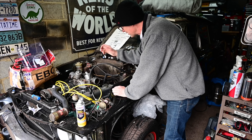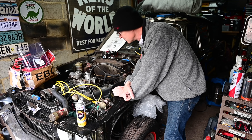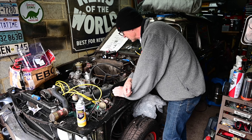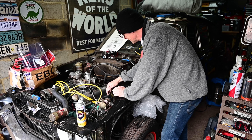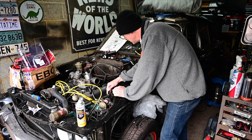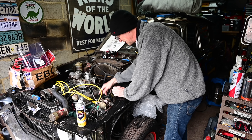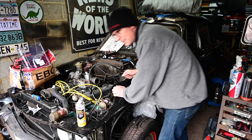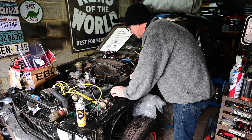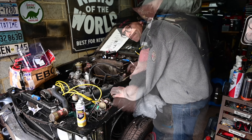At least one cylinder, even if I've gone really crazy with the mastic stuff, at least one will be getting petrol through and that one will be coughing. We wouldn't just get that one single cough at the beginning and then nothing. I can't smell petrol on either of the two spark plugs I've taken out, and the blue paper test was a fail as well. I'm properly confused.